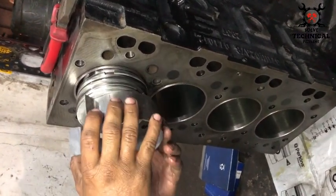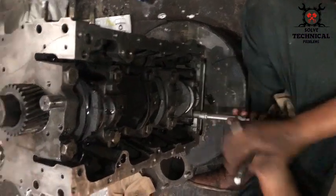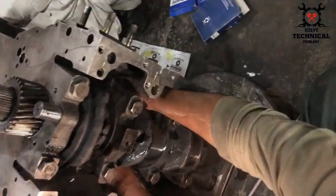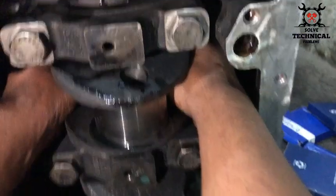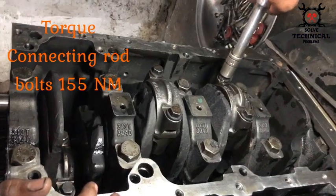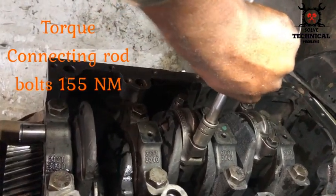This is the ring clamp or ring clip. After sliding the piston into its bore, install the cap. The torque for the connecting rod is 155 Nm for the Perkins Phasor 4 cylinder engine, Perkins 1004.